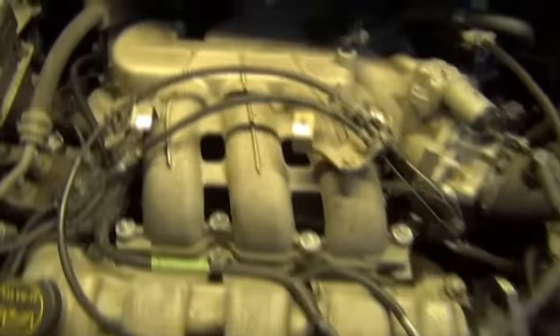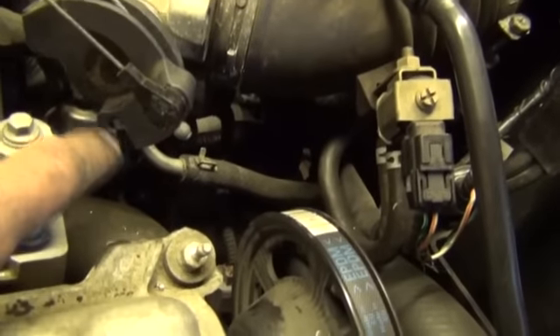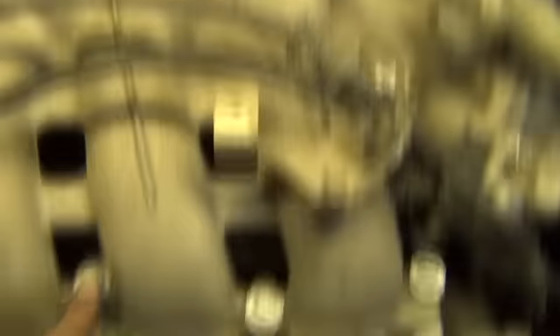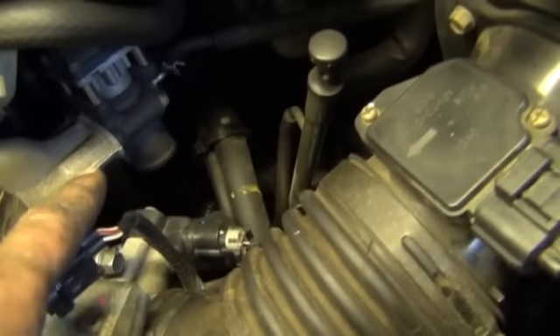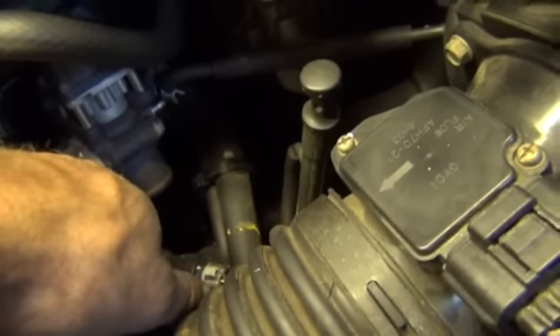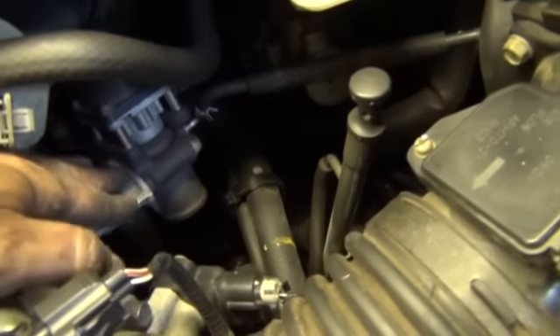I'm done except for the vanity cover. You have to take these throttle cables off — there's a bolt here, two bolts here, this slides down, and this cable just pops out. It's a mechanical cable, just slides out. There's another intake manifold holder back here on the left that you have to get some bolts. This should pop off from a retainer — there's another one like this style in the back and another one just above the PCV valve. You have to take this unit off right here; there are two bolts and a metal gasket. My gasket fell down — thankfully I was able to get it once I had the plenum off. Just keep that in mind when you take this off: watch out for that gasket.